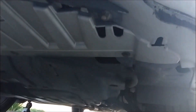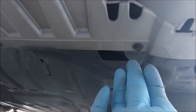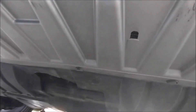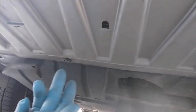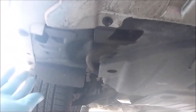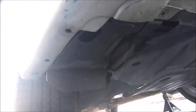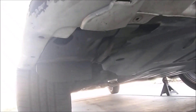At the bottom of the car there are clips all around, like this one here. There are also bolts — two of them, one over here and one over there. Remove the other clips and bolts along the bottom on both sides. Once you remove all the clips and bolts on both sides, it's time to pull out the bumper.